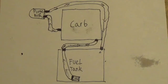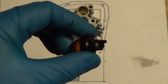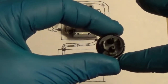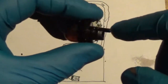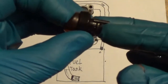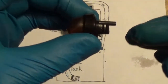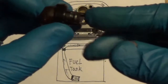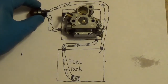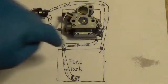Here's a crude diagram to illustrate that. One thing that helped me understand this: I always knew these bubbles were one-way valves. If you want to know the inlet, most of the time it's the shorter one, or they'll actually write in text which one is which. If you plug your finger on the inlet and push the bubble, it will allow air to go back out but air can't come back in — the bubble can't expand until you let go. And likewise, if you put your finger on the outlet and plug it and try to push the bubble, it won't let the air out. That's what made this easier to understand: you're not pushing the fuel into the carb — you're actually creating a vacuum when the bubble expands, and it's pulling the fuel through the system, not pushing it.